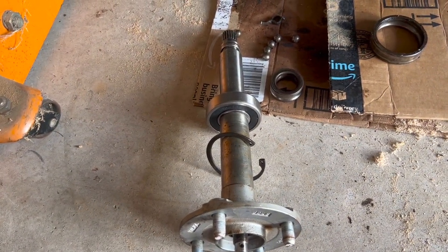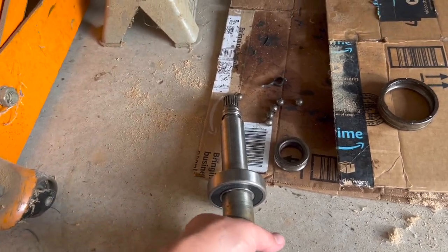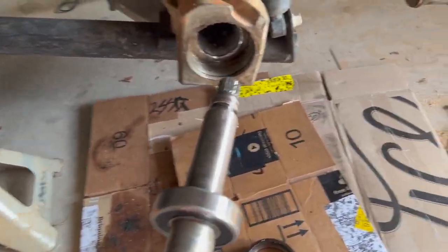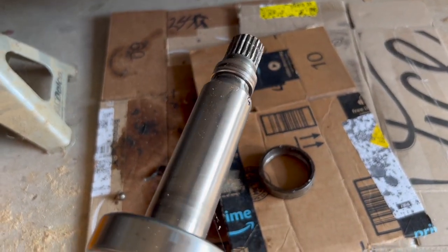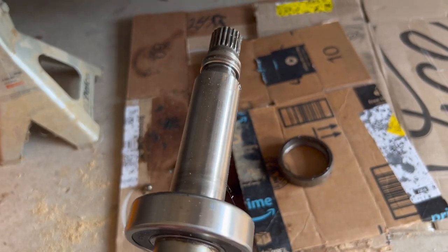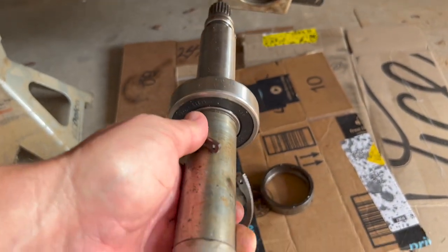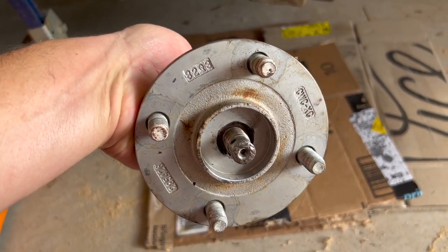It took them about five or ten minutes to do all of that process, including removing the old one for me. So now I've sprayed brake cleaner inside the hole here. I'm going to clean off the tip of this with brake cleaner just to get that little bit of dust off of it. We're going to slide this into place and get this little split ring put back in to hold everything together, and then we will assemble this side here.